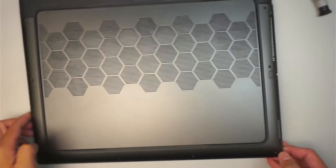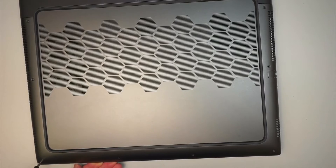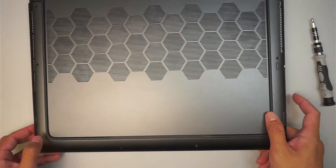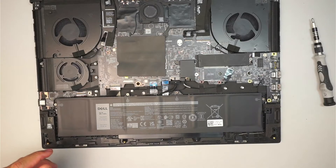At this point, go ahead and gently remove the cover. If the cover is still stuck, the screw may need a bit more unscrewing. Then slide it down towards yourself to remove the entire back cover.